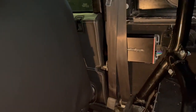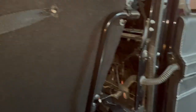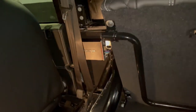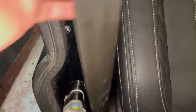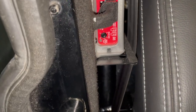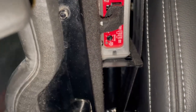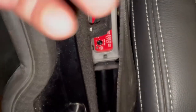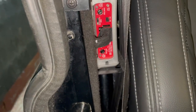The rear speaker wires are coming out there, running up to the stereo for the audio control. For the rear speakers we're just going to put in some larger 13cm Focal K2s. Also got the reverse camera wire to get up from the back. I didn't want the seatbelt rubbing on the amplifier, so we've just got a bit of metal - an L-bracket - with some cloth tape over the edge. That makes sure it doesn't get in the way of the seat moving backwards and forwards, and stops it rubbing up on the amp since the amp's going to get warm. It all tucks away nicely and is accessible.